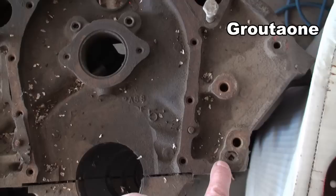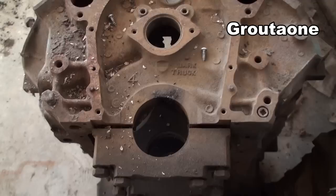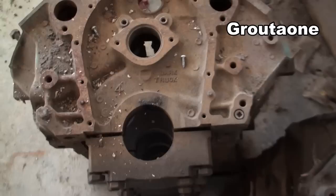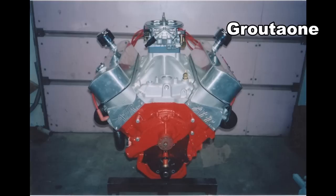Both of these blocks have a little plug here on the front beside the timing chain cover. That's actually an oil gallery and it runs down the length of the block — they drill them out and put a plug in there. The tall deck has that too. So you've got to be careful if you put in a really big crank and do a lot of clearancing for those rods, that you don't clearance your way into that oil gallery. That's where the aftermarket blocks are nice — they move that oil gallery up and alongside the camshaft, so you no longer have it there and you have room to do a lot of extra clearancing.